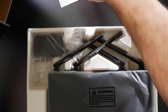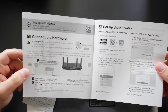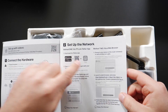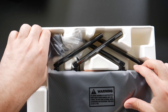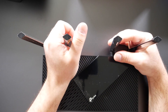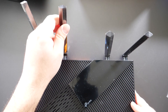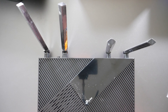So some instructions came out of the box — a quick installation guide showing how to connect it to your modem, which is always helpful. It also tells you to get the Tether app, which I've used for the other TP-Link routers. It does come nicely packaged, and you can adjust your antennas — these antennas actually make a difference. Depending on how you point them, it can literally make a huge difference, so it's very important when installing these routers to play around with the antennas and point them in directions where you typically use Wi-Fi.